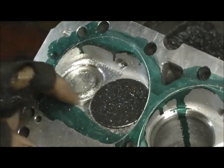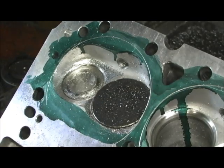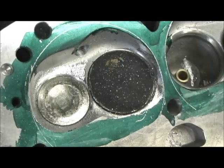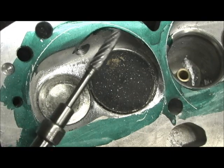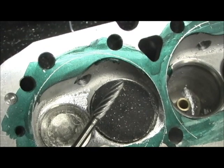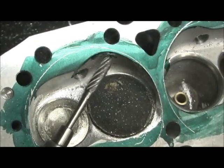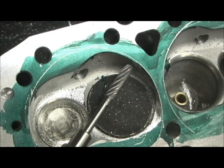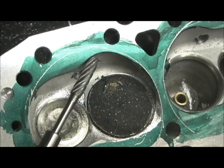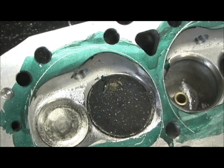Now that right there is the main thing. That's as far as I can go with the valves in the head — I'll have to go in and remove them. There is a little bit of trimming, but not much. I do go in there and touch that shape, but I have to switch to a different cutter. I'll use an egg, start right here and lay that back just a little bit, and then that pretty much takes care of the combustion chamber part.